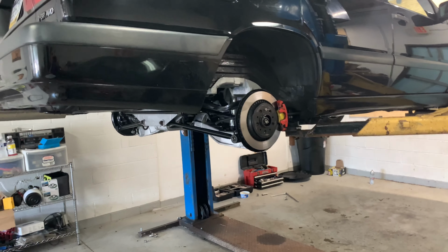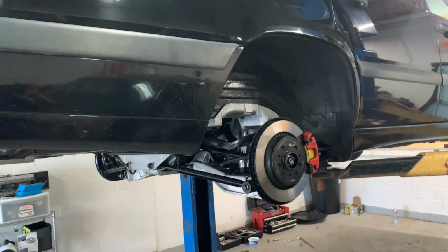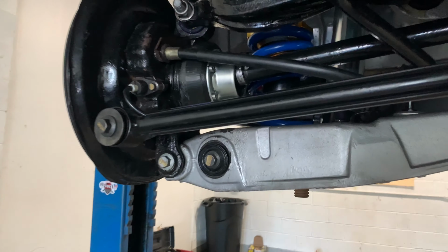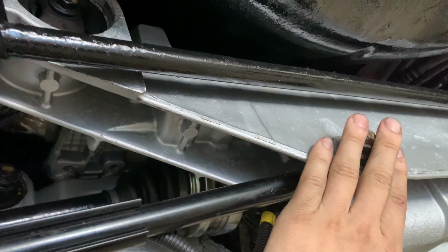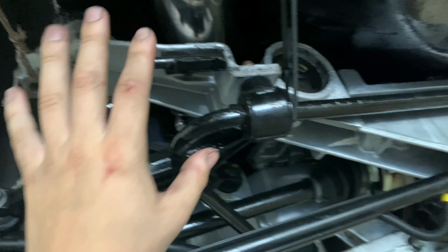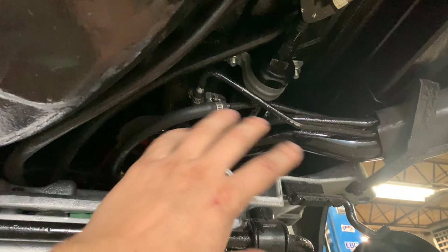So now that the car is running, I did like 10 miles on it with the new axles and everything, but I just about rolled over to 500, so I want to do a nut and bolt check on literally everything. So I checked all the subframe bolts. There's three on each side. I checked these bolts on both sides, checked all the V-bands. I checked all of the fuel system stuff. Surge tank up here is fine. All the fittings are great, all the electrical connections. So I looked at all the EVAP stuff and that stuff's all nice and tight.